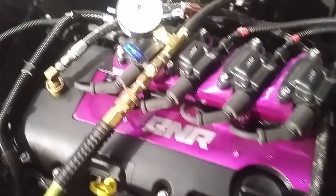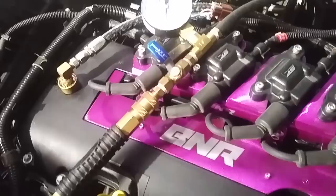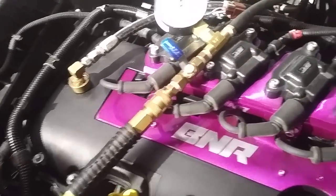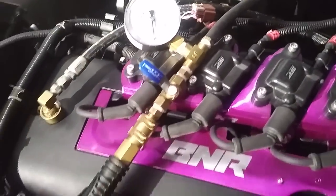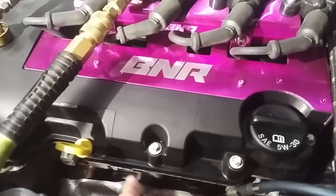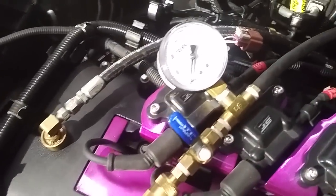So you've got quite a few leak points, and the best way to find how much you're leaking and where is with a boost leak tester like this. I will warn you that you will have some leak that you're not going to be able to find the source of - my best guess is that you're basically pressurizing the crankcase, which is not really normal, and probably spitting out a bit of air through your valve cover seals and also moving air through your turbo seals. But it's not going to be enough to be a big deal.